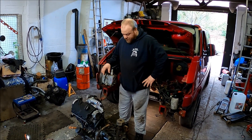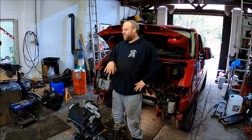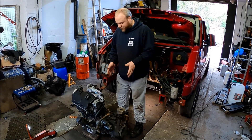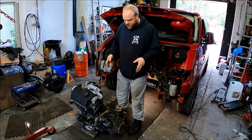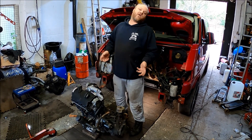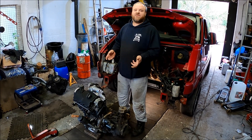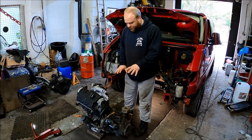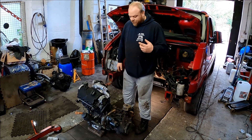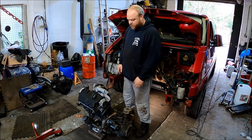Clutch-wise, we've used a G60 flywheel, a VR6 clutch, and a set of ABF flywheel bolts from the old 16-valve engines. That conversion was very common for the old 20-valve turbos with the five-speed boxes, because the box on this engine is pretty much the same — an O2J five-speed box from a 20-valve turbo. The ratios and bell housing are different but the input splines and overall structure are very similar, so a lot of these parts fit. The G60 flywheel does fit, and we use the original T4 starter motor.